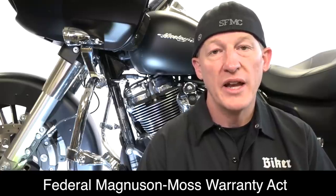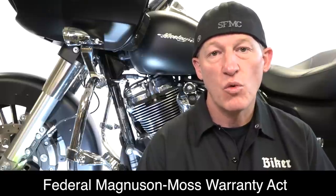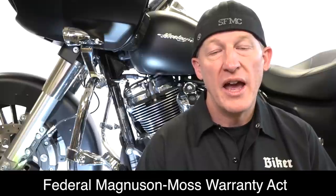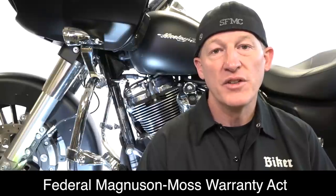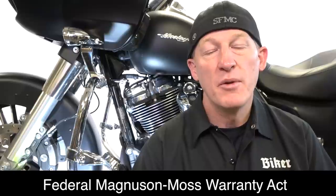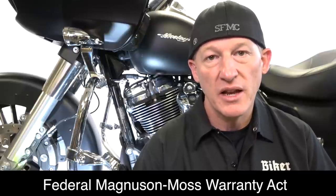So the question is, does doing your own oil change on your Milwaukee-Eight in your garage void your warranty? It absolutely doesn't void your warranty. You're federally protected by the Magnuson-Moss Warranty Act. Go ahead and look it up. That means dealerships can't force you to have them do your oil change. There is a couple things. You just need to have your owner's manual. You need to sign it, put the date that you serviced, and keep your receipts for the product you purchased. We've been in this game a long time, and we have talked to many dealership mechanics and service writers, and they will tell you the same.